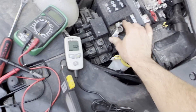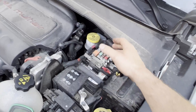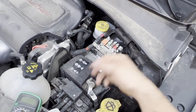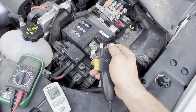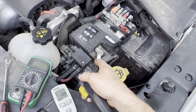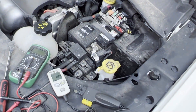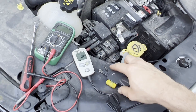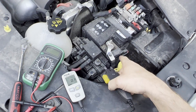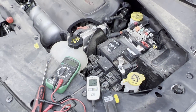Once you're done checking for a draw, go ahead and reconnect your battery or replace it, whatever you need to do. To summarize: it doesn't necessarily matter if you do positive or negative — you just have to leave one connected, disconnect the other, and hook your amp meter in line between the loose cable and the empty battery terminal. That gives you your reading. In some instances it may take 15-plus minutes for everything to power down, so I recommend using extension wire leads with alligator clips so you can clip it and not have to hold it.